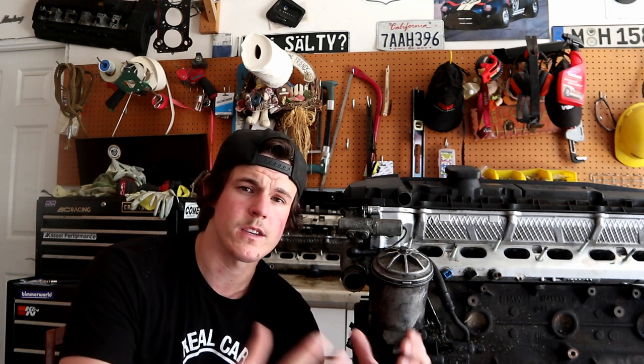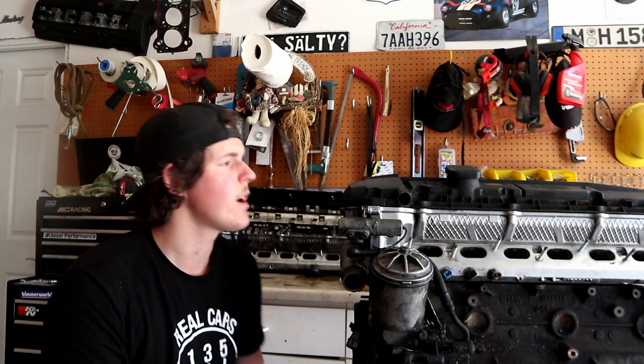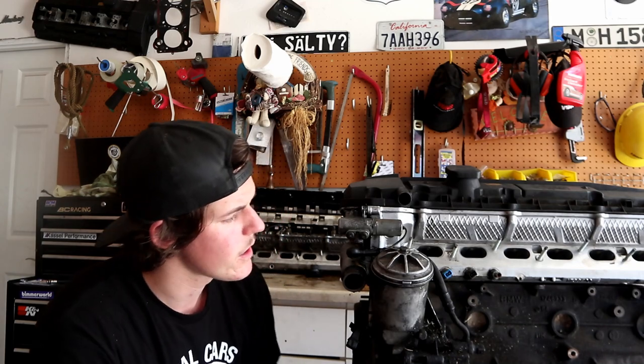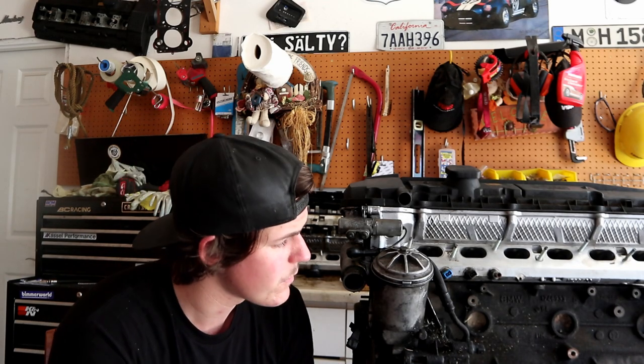So you're taking the control arm off of the spindle, you're taking the lollipop bushings off of the chassis, and you're dropping the subframe completely out of the car to get access. So you do have to have a brace. Usually you'll brace it against the shock towers to keep the weight of the engine up because you can't unbolt the subframe with the engine on it still. So you gotta undo the engine mounts, drop that, and then you can start working on the oil pan itself.